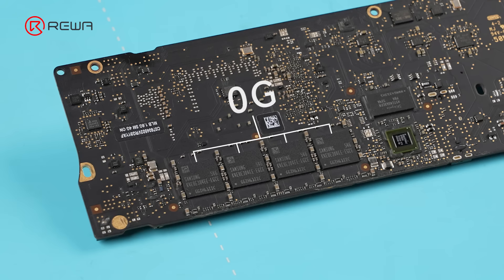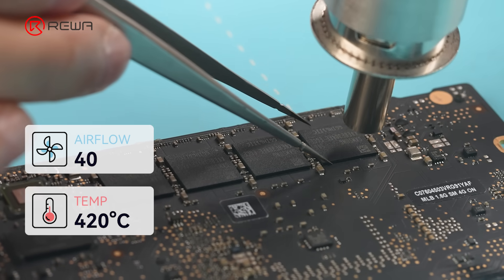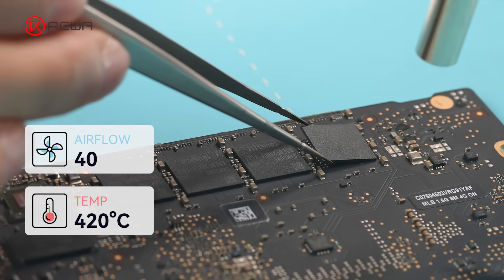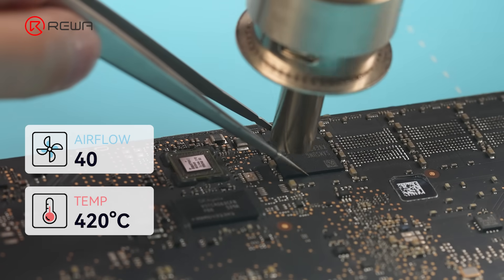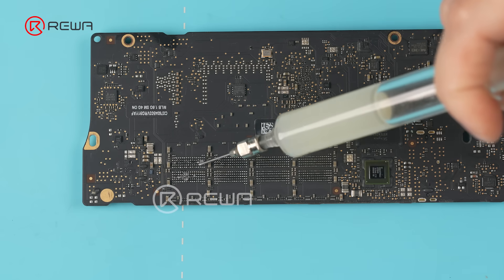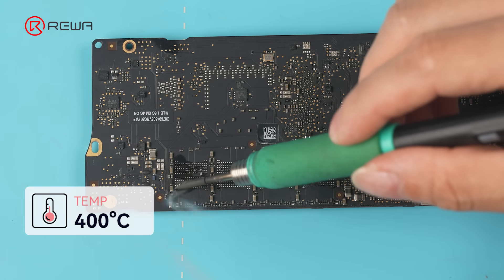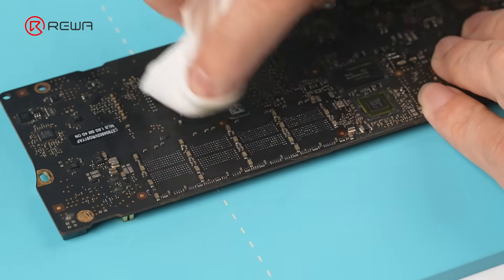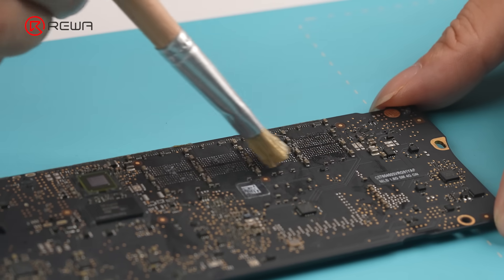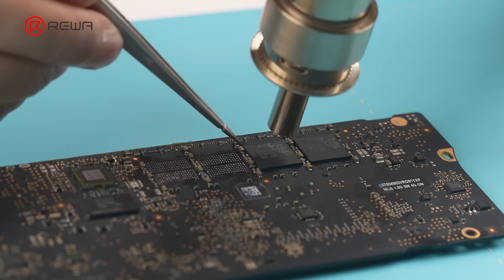Now for the MacBook RAM chips. Each chip is currently 1GB — we'll replace them with 4GB each for a total of 16GB RAM. Heat the RAM chips with a hot air gun, keeping a circular motion, and remove all 4 chips with tweezers. You may need several tries. The pads need cleaning — apply flux just like with the CPU pads. Use the solder iron and low-temperature tin to smooth the pads. Clean the pads with a lint-free cloth, apply flux again, and spread evenly with a brush. Then solder the 4 new RAM chips back in place, gently touching them with tweezers during heating. Make sure they are all soldered firmly.